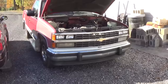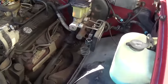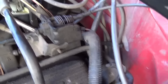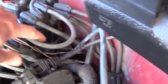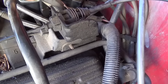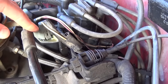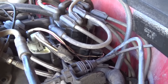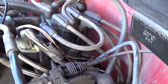Here we are on the job site. Got this classic Chevy 5-liter V8 — look at all the room under the hood, probably just sit on the fender and go to town. There's the distributor, ignition coil right here, and that right there is the ignition module right under the distributor — HEI module. We've got two connectors on the coil, pink and white. Let's give it a crank and check for spark.